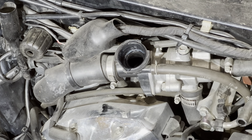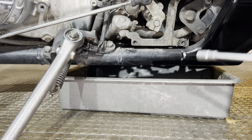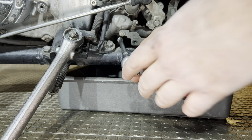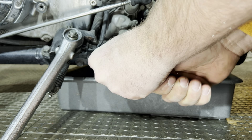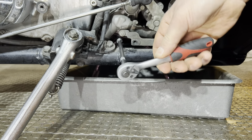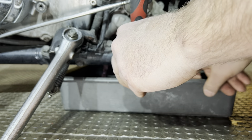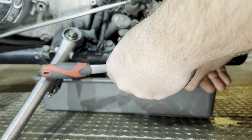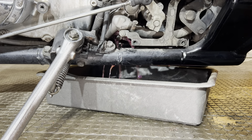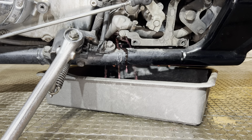I don't really like the fuel tank removal procedure on the VTX because there's no shutoff valve — the pipeline goes straight from the fuel tank. When you disassemble the fuel tank, the fuel starts to leak and you can't do anything about it. You just need to plug it with your thumb or something and get a canister ready to drain the fuel straight away.